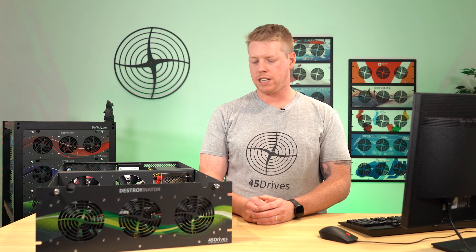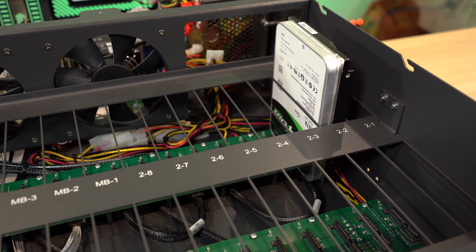This is to allow the opportunity to wipe SATA 1 drives and SATA 2 and 3. The slots numbered 1-1 through 1-15, as well as 2-1 through 2-8 on this particular model, can handle the wiping of SATA 2, 3, and SAS drives. We added this feature because a lot of the feedback we got from our customers was the need to wipe older legacy SATA 1 hard drives.